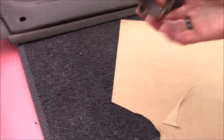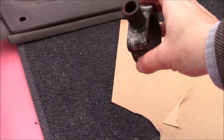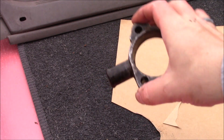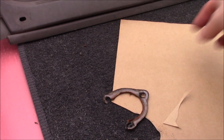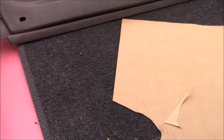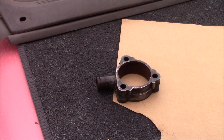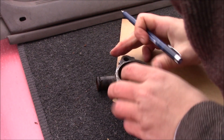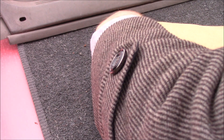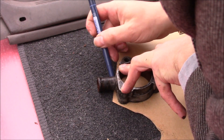I removed the remains of two gaskets, and this is — I don't know what you call it — it's like a spacer thing. Because somebody's obviously cared about maintenance on this car — missing thermostat aside — everything is coming apart really easily. It's actually really nice. I did originally try and trace the remains of one of the gaskets, but it's a bit wibbly-wobbly and I wasn't very happy. There's a couple of different ways you can do this — you can do it with a hammer — but given how small this is, I'm just going to draw around it with a pen and then cut it out. I was expecting the thermostat I bought to come with gaskets, but it doesn't. It just means a little bit extra time doing this. Not the end of the world.